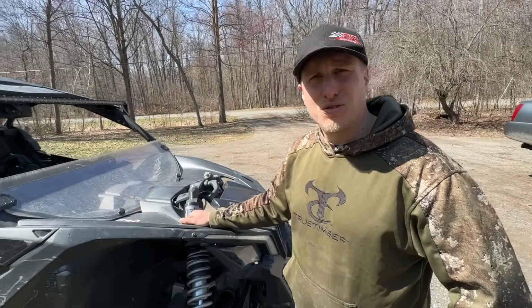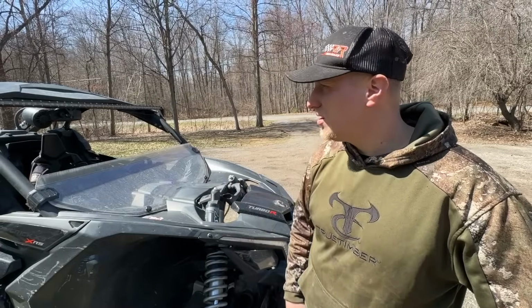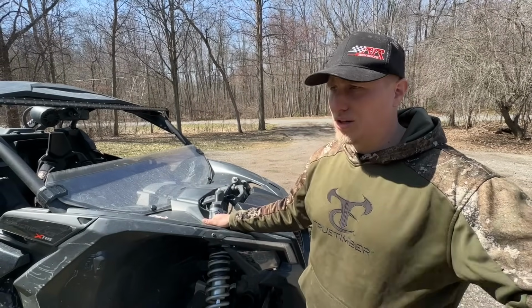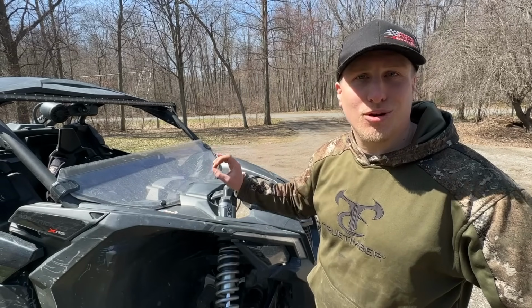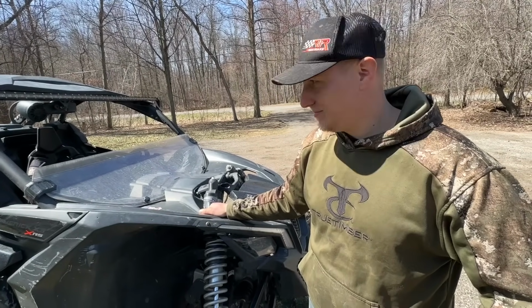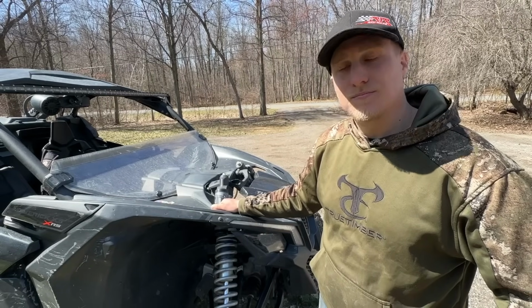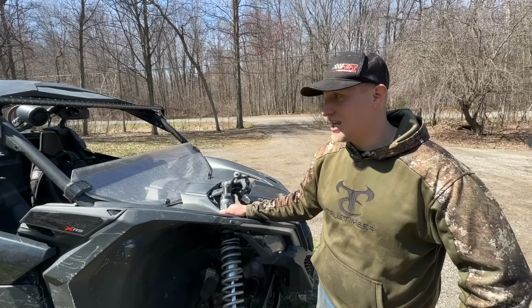It made 252, the highest we've had on the dyno. Could change the ramps out, bring that RPM up a little bit, but with the FP green turbo on there, she's going to rip. So we'll do this Side-by-Side USA race with the stock turbo, then put that green back on and get those STMs dialed in for that. Should be a beast, honestly. It's going to be super fast.